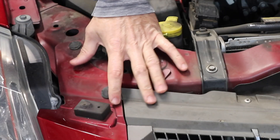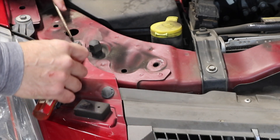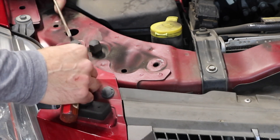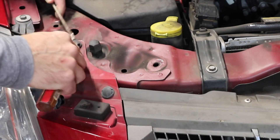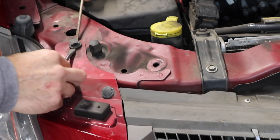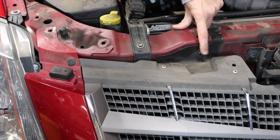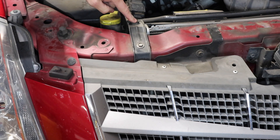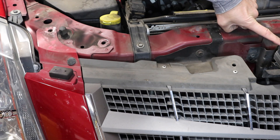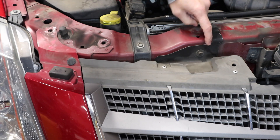Next thing we need to do is get the front of the bumper and grill loosened. You're going to do that in two spots. One is this pry-up clip here — just take two flat head screwdrivers and wiggle them into each depressed area on the side. That will pop up and then you can get under the main piece and pry that up as well. Should come right out. Second is this 10 millimeter bolt. There are three of them: one holds on the bracket for the radiator, one holds on the grill, and one holds on the hood latch. So it's the middle one for the grill that you need to take out.